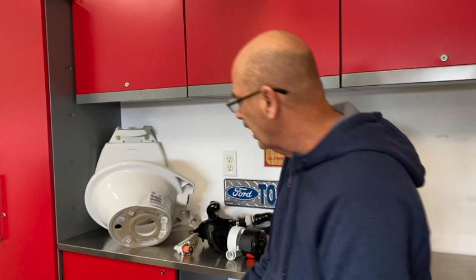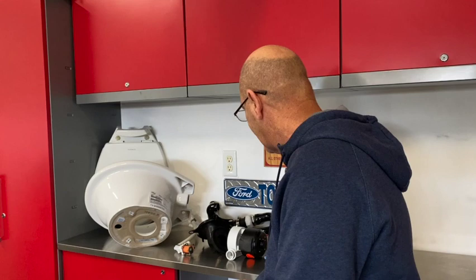In mid-2019, the REV Group — which is Fleetwood and Holiday Rambler — on some of their base models up through their Discovery lineup, they got rid of the vacuum flush toilets and went to macerator toilets. Anyone who's had the vacuum flush system has known its problems and quirks. This Dometic — called the Master Flush Series 7640 — is a phenomenal toilet that's been in the marine industry for many years and is fairly trouble-free if proper maintenance and care is given.